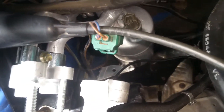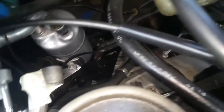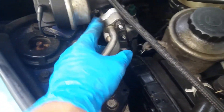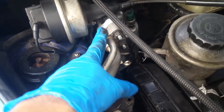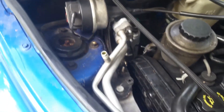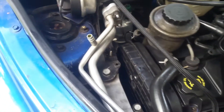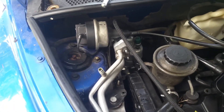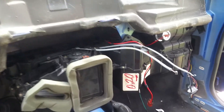I've got that lower bolt holding the dryer and now I'm getting ready to reattach the pressure switch. We're going to go ahead and get our hoses back on — we've got them taped and plugged. The big one goes on the bottom and then the smaller one on the top. We've just put our lines back on and re-tightened these 13 millimeter fittings. I wanted to point out that the dryer came with seals already on it that connect to the evaporator and to these lines — make sure that yours has the seals on there.